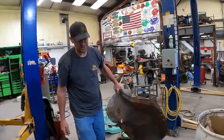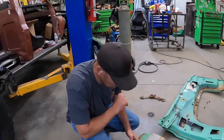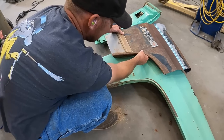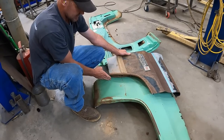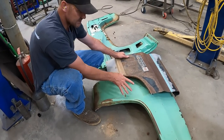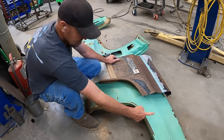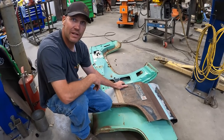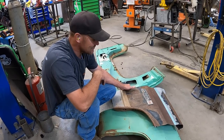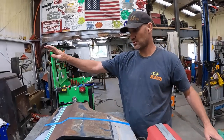These will get salvaged and used on something else - well, Landon's truck. What I'm thinking is if we make a straight line from there right up over all that and cut it off, then we can come back here and cut this one off and graft it back together. That'll give us our fender piece. We'll weld this to this, and then this to the other one. So we've got lots of sheet metal welding to do. I've made my mind up - I'm cutting that off, it's gone.